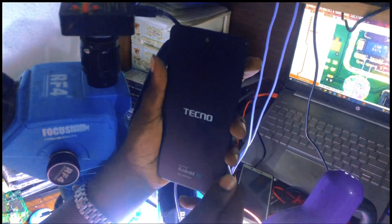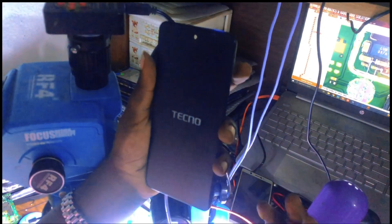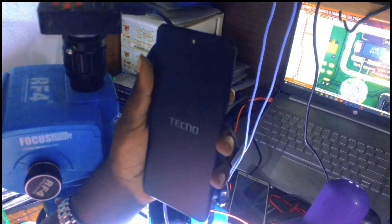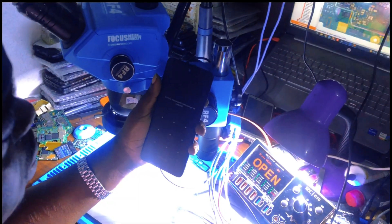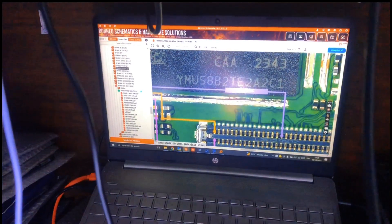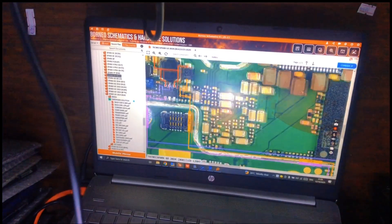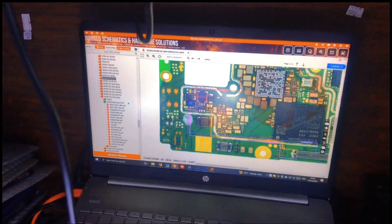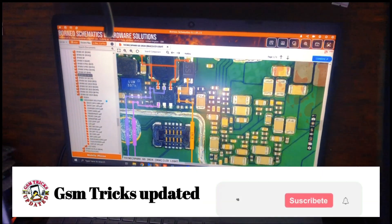Wow - fixed! Every time you have to troubleshoot your mobile phone and see what the problem is. Here we had the problem of the backlight - the problem was this LCD CABC line. This line was missing. Now I made a jump from here to here and the phone is fixed!